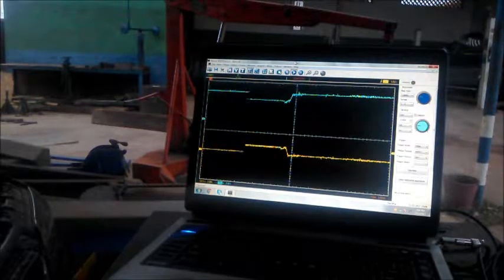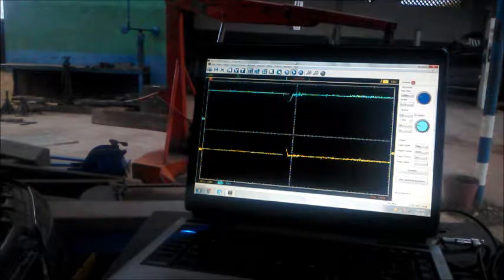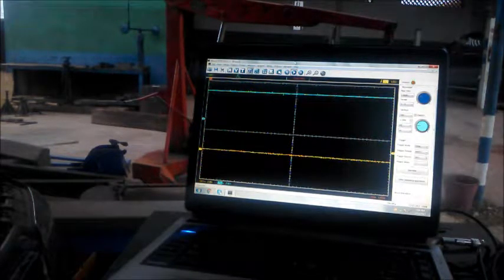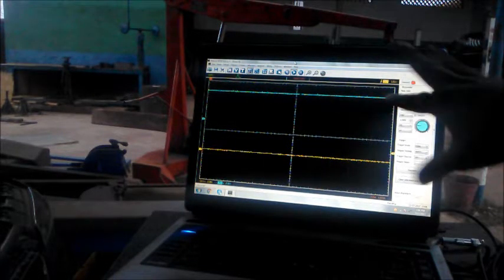Yeah, there's funny stuff going on. I think it now has a fault code in memory for that throttle motor, and it's now holding the motor open. That's unusual, but I'm sure it's some kind of strategy.